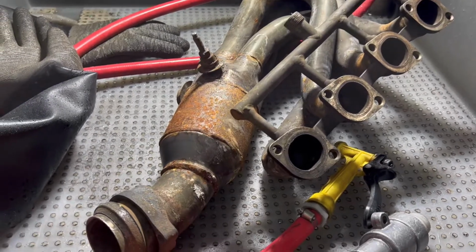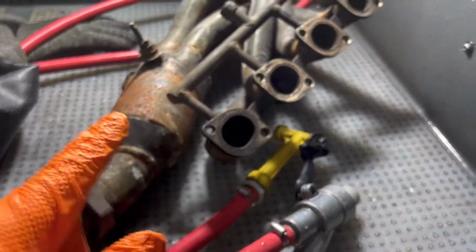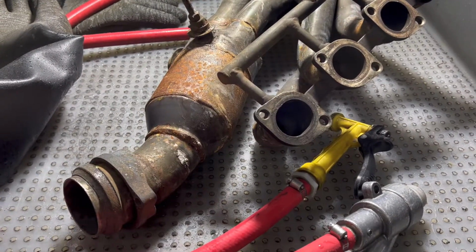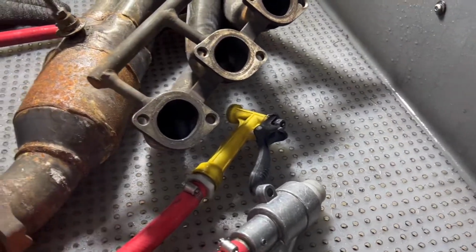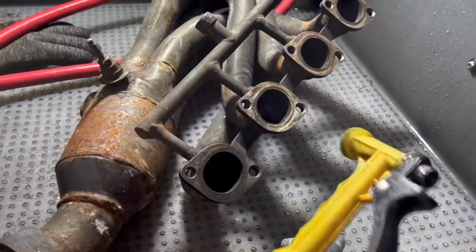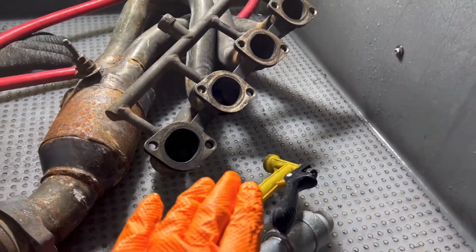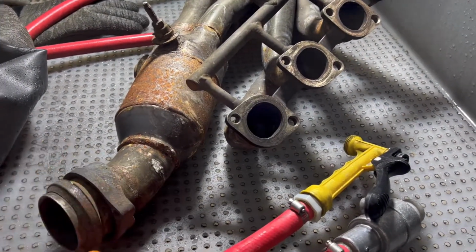But yeah, definitely with what happens, the water level goes up because there's a sprayer. It's right there. And then it sprays on the glass to keep it so you can get a good visual on the parts you're cleaning. And also with media that gets on whatever part you're blasting, sometimes you've got to spray it off to get a good look and make sure you got all the areas. And that will make the water level in here rise. So I'm going to drain off some of this water now and get it to the right level.